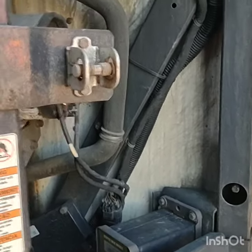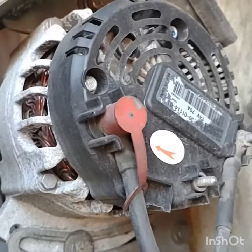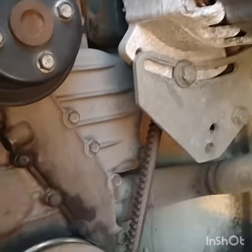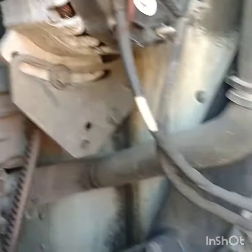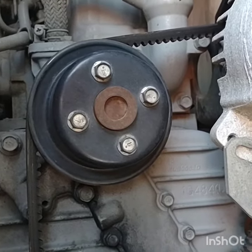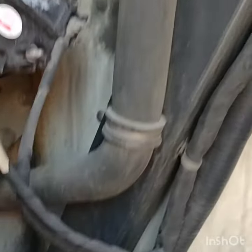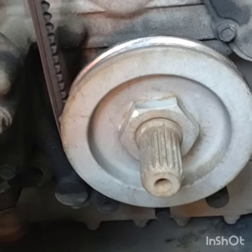Let's start by checking inside the driver's side door here. We can get a good look at the alternator right there and check for corrosion around the connections. What we're looking for on the belt is the tension — that's pretty good right there. Make sure the belt isn't cracked, worn, or showing signs of aging. Up here we got the water pump — checking for leaks, see if there's any coolant. We got a coolant line there, so we're checking for coolant leaks, any kind of leaks really. Looking down in the bottom there, everything's nice and dry — that's what we're looking for.